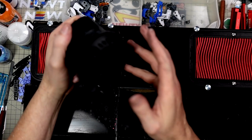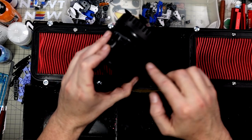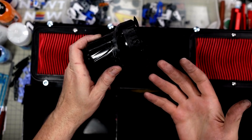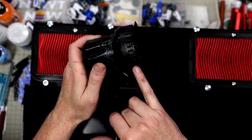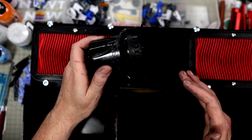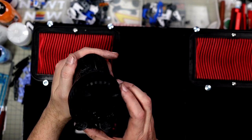I do like the pump though. It was easy to take out. The pump is nice and big. I had really no issues with it, and you can see where debris got on top of the water and then on the pump. But this pump is pretty big. So what ends up happening is if the water level gets down into here, like you don't have enough water in there, or it's not flowing through here fast enough, then you start getting splashback, bubbles, frothing, all kinds of stuff. So ultimately, you want to do the 1.1 liters that ends up fitting into here. But I think I've fixed that issue. It seems to be working very well.